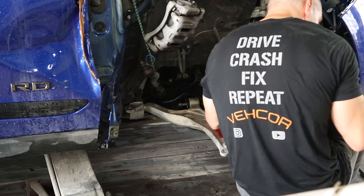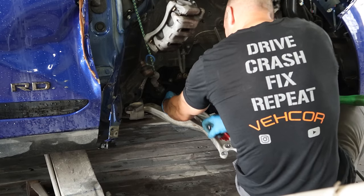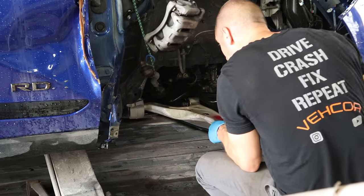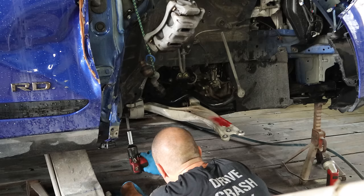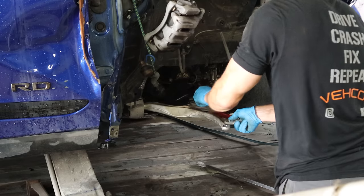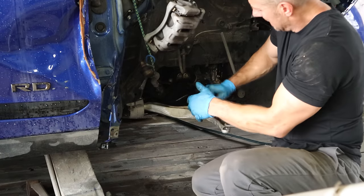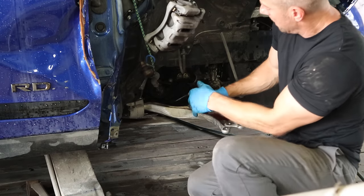I'm fighting with our famous front bolt. I got the pry bar sitting on my knee holding the sway bar up so we can get our bolt in and try to tighten it up. It goes through one ear of the subframe and then the other ear has the nut welded to the back side of it, so you've got to get it in there straight. Once you get it started it's pretty easy — just about a million eighth turns until it's tight. Start our bolts in the back, then tighten down those rear bolts to manufacturer specs for electric ugga-duggas. We're going to load the control arm — basically put it where it's going to be when the car is sitting on the ground so our bushing will be where it belongs, not stressed and twisted little by little.